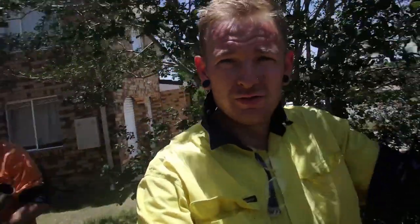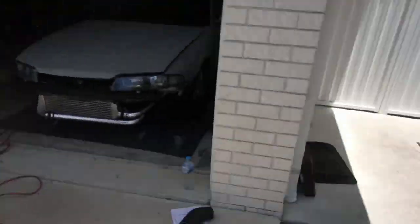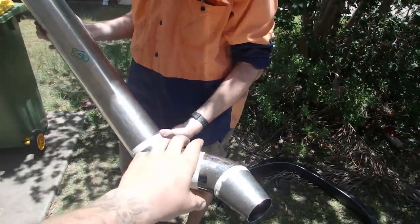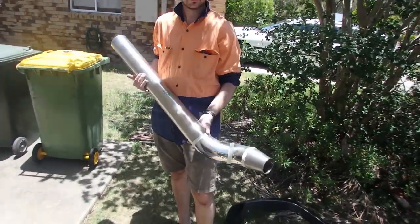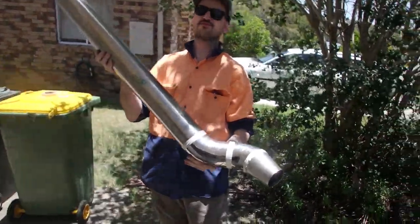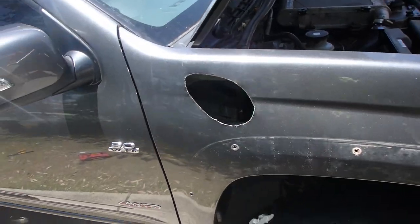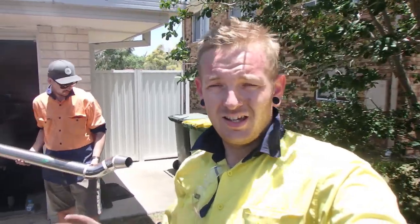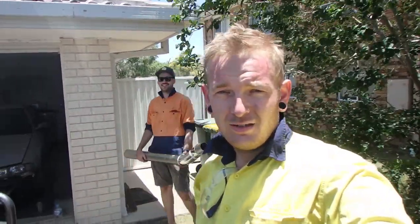From what you could see before from the cutting and sanding — this is the progress we've come to. We've found our hole and worked out what's going on behind the guard. Four inches at the top comes all the way down, we've got a 45, another 45, then we've got to reduce from four inches down, all the way into a 90-degree fitting into the air box. This is what our stainless steel short-entry snorkel looks like so far — Australia's shortest entry on the guard. This is the end of day one. Hayden works FIFO so we'll work when he comes back — it'll all come together in one video.